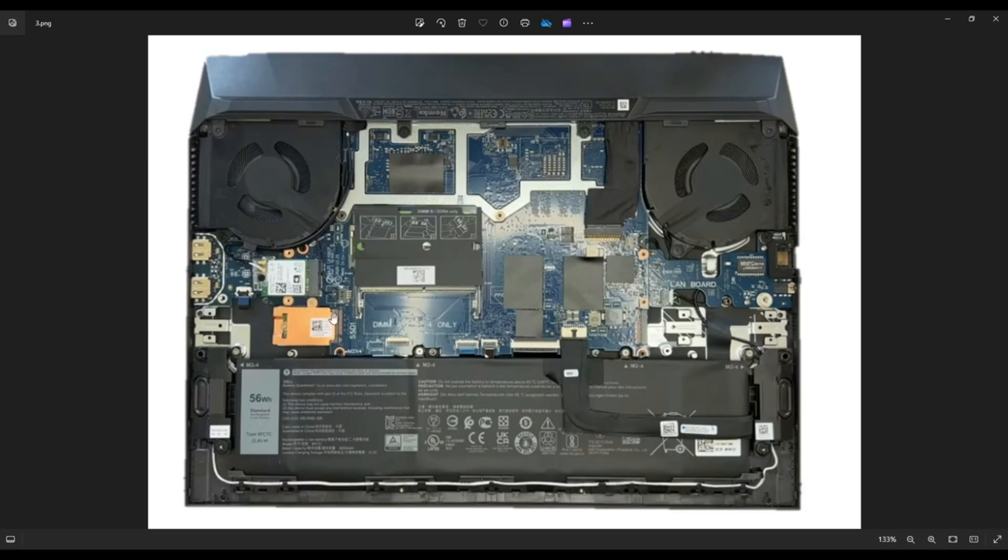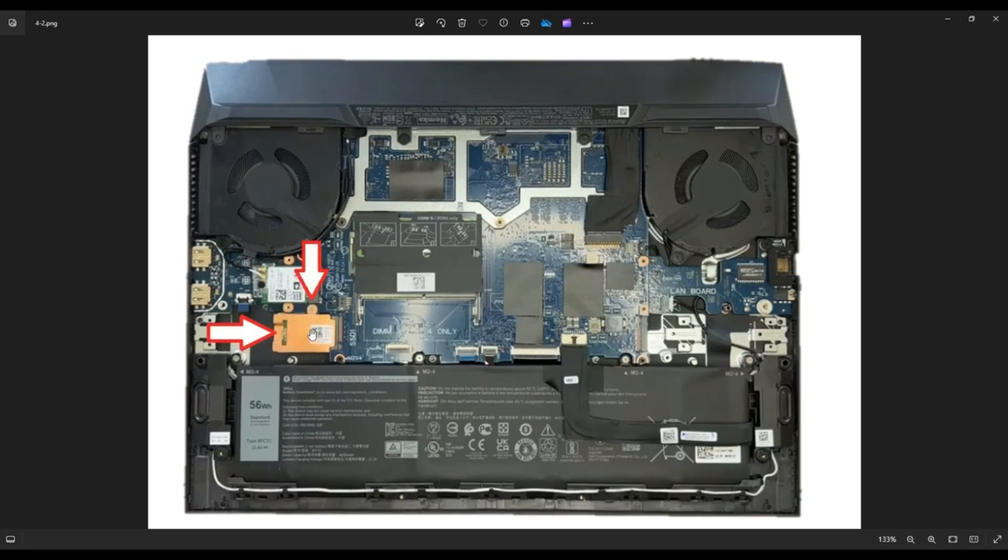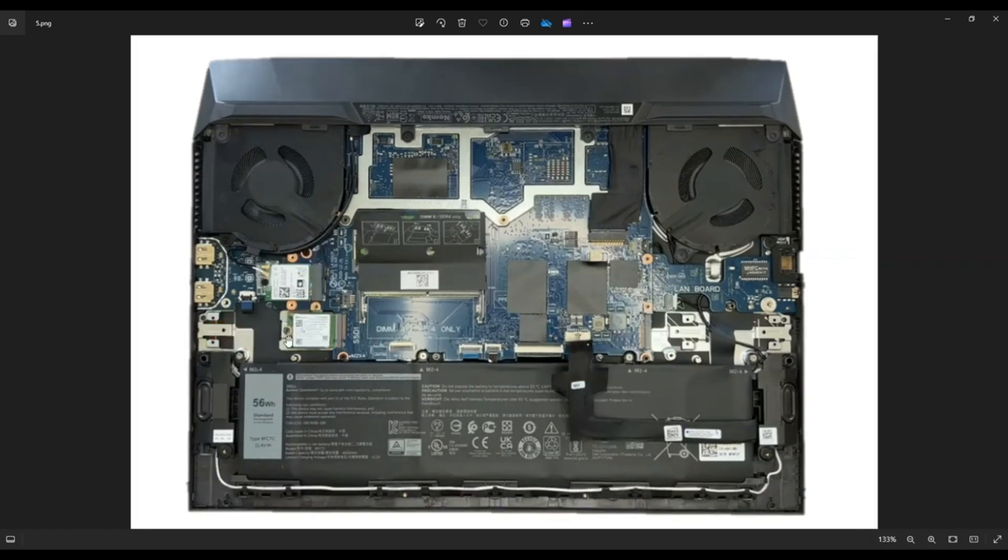You have your stock solid-state drive right here under this copper shield. To get that shield off, there's a screw on top and also a screw to the left — that removes the shield. There's a single screw that can be removed and the SSD can slide out of this M.2 port. In addition to this M.2 port, there's one on the other side of the computer, so you can upgrade and add another solid-state drive. This solid-state drive is PCIe NVMe and can take Gen 3 solid-state drives. The Dell part number for the replacement is 0WYTPM — I'll have that information below in the description.